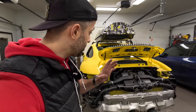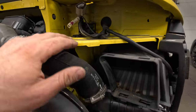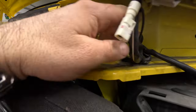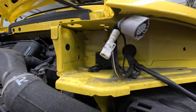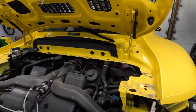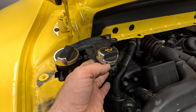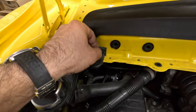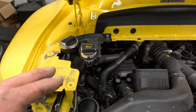The first time doing it took me 30 minutes — two things to note. Before you remove the bumper you have to disconnect the cables behind the taillights. To disconnect them you release them from a little flap — open up the flap, both cables come out, and then you can simply unplug them. When you remove the spoiler it is absolutely crucial that you loosen up the oil filler cap; there's a 10 millimeter here, you loosen it up and then you can wiggle it out.